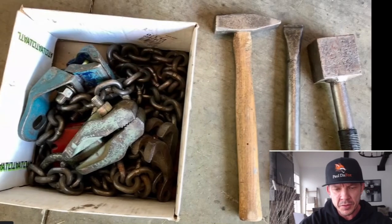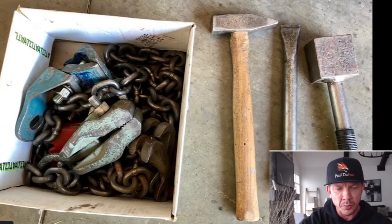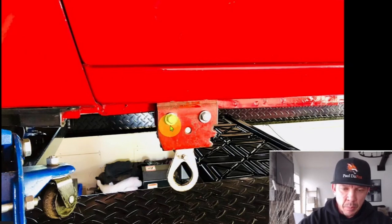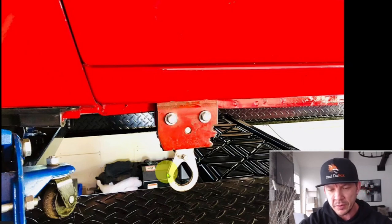What I first did was I went over to my local body shop — they're just down the street from me, awesome guys, Little Auto Body. I borrowed some old-school pulling tools and I put a metal puller onto the pinch weld. This bites hard, so the tighter you tighten these bolts, the more it's gonna grab onto the pinch weld.